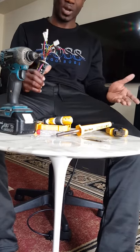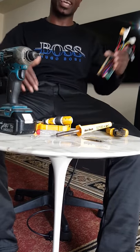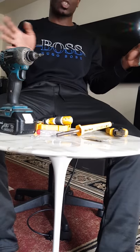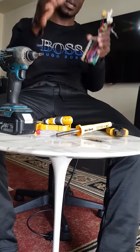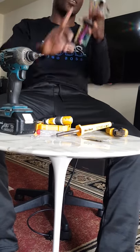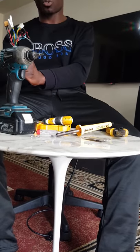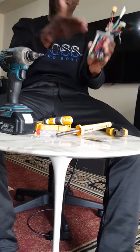It doesn't matter if it's the Q1 Hammer, if it's the Ultra G, if it's another scooter. A scooter has a simple system. They've got motors, they've got controllers, and they've got a battery. Every electric scooter has all this in it. The rest is just something outside. Somebody might make it faster, somebody might use bigger batteries, somebody might use a high-end controller, but the basic setup is that any electric scooter that moves is going to have a motor, a battery, and a controller. So whatever scooter you've got, if you have any problem, follow the same procedure: check which sort of controller you have, follow the wire connection, follow the steps of testing what's wrong with the controller, and get it repaired or replaced.